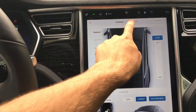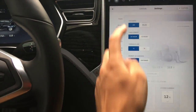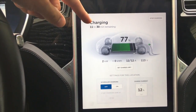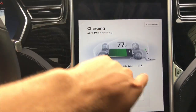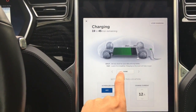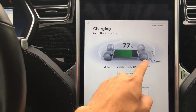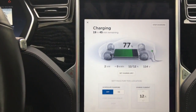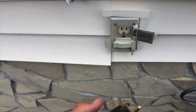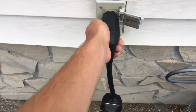Let me check exactly how much. Going to units and format, energy — so I'm at 77% battery and it says 11 and a half hours to charge just to that point. If I set the charge limit to full for a big road trip, it'll take 20 hours just to charge that much — well over 20 hours from zero to 100. It's just a simple 110 plug.